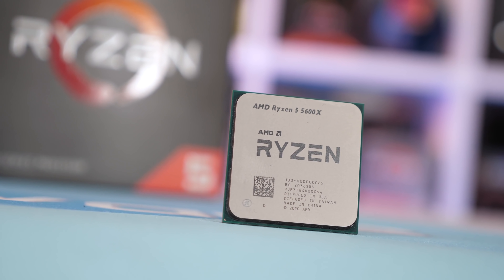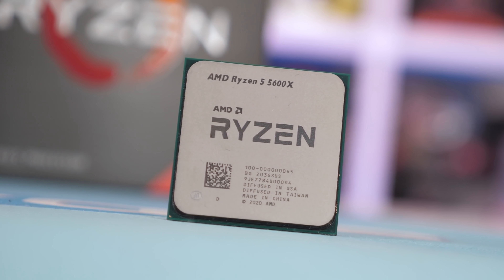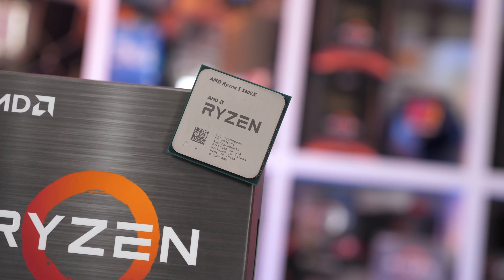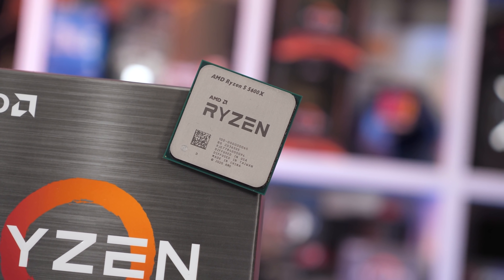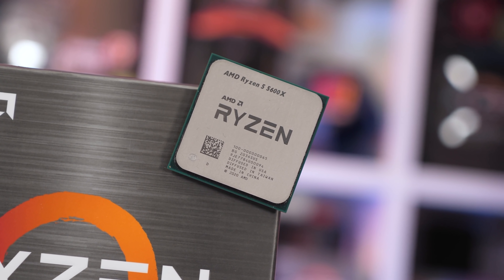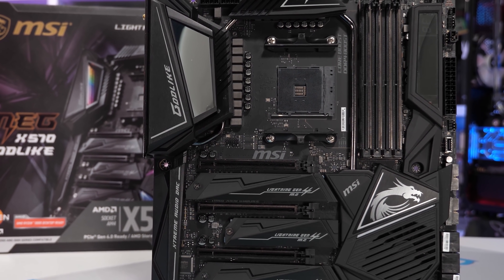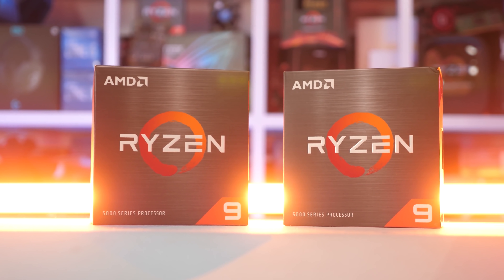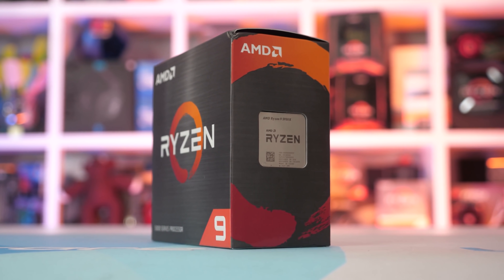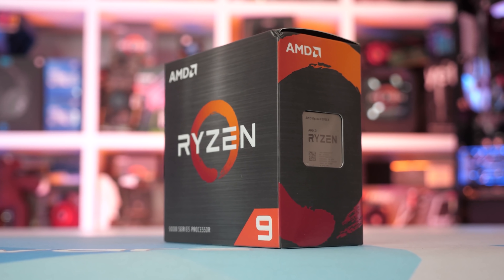The most obvious difference is in the packaging. Cezanne, like AMD's previous APU designs, is monolithic, so all elements are included in a single piece of silicon. In contrast, Vermeer — the desktop CPU design — features an IO die with chiplets. Neither is necessarily better or worse, but AMD do have different design approaches for different products. In terms of specifications, AMD's Ryzen 5000 APUs only include up to 16 MB of L3 cache and only feature PCIe 3.0 support from the CPU. We still get 20 lanes accessible to the GPU and storage, just not the newer PCIe 4.0 standard. The desktop lineup offers double that cache again with 32 MB in up to the 8-core models, and also includes 12 and 16-core models which aren't possible with AMD's APUs.